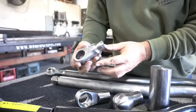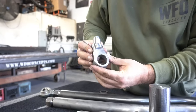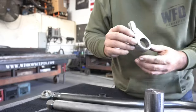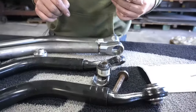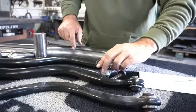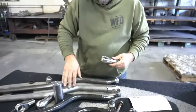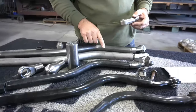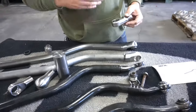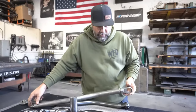This is the cool last operation. As you can see, it's at an angle. The reason we machine this tube insert piece at an angle is to duplicate this sharp bend really close to the end of the track bar. If you look at these two side by side, our track bar actually makes the bend quicker than theirs to help clear the differential. This special bend allows it to work with Dana 60 axles and heavier diff covers that stick out farther. We've put this on my stock 392 with a heavy-duty diff cover, no lift, and full cycle up and down did not hit the track bar.